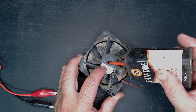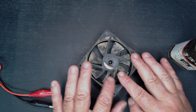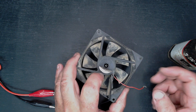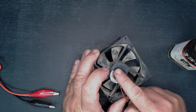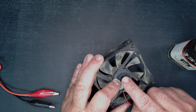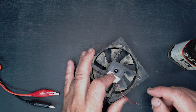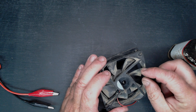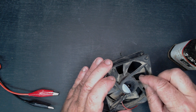Usually the fluid bearing is on the frame part of the fan assembly, not usually on the motor itself — it's on the actual mount. So I just pulled it out of the way, put a few drops of oil on there, and made sure it turned, because what was happening before was whenever you powered it on I saw it juddering — going around but juddering.